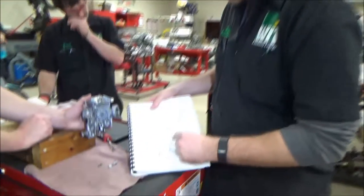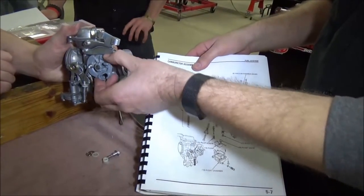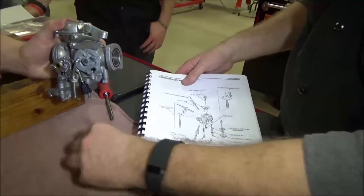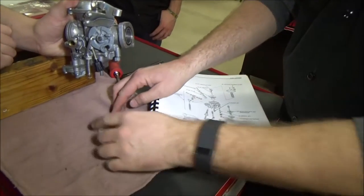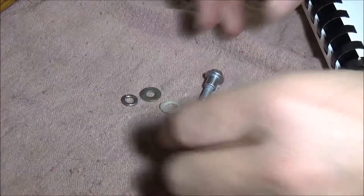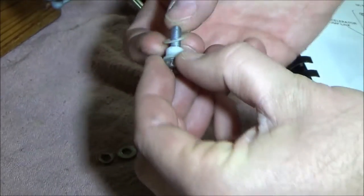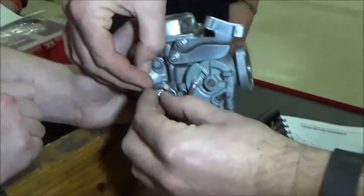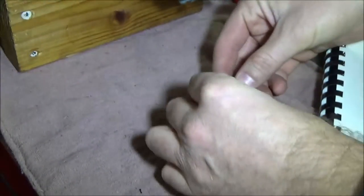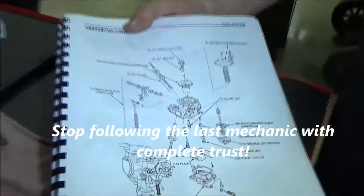What I'm going to demonstrate here is these pieces that mount the accelerator pump cam to the carburetor, so that when we open it, it'll operate the accelerator pump. It's not real hard — you look at the pieces and you see a shoulder bolt, a plastic collar, a plastic washer, a lock washer, and a flat washer. The way he took it apart was wrong — this was built up in the wrong direction with the plastic piece behind, and it's just not the way this is supposed to be put together.